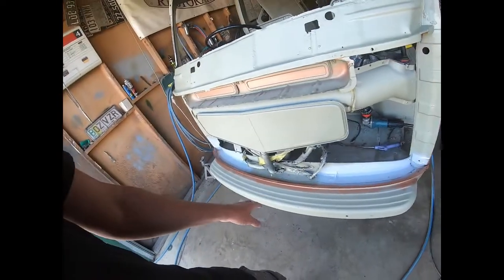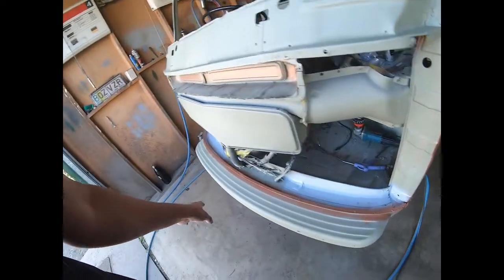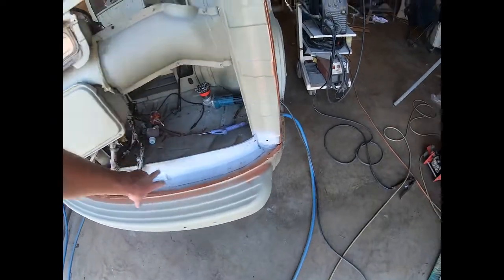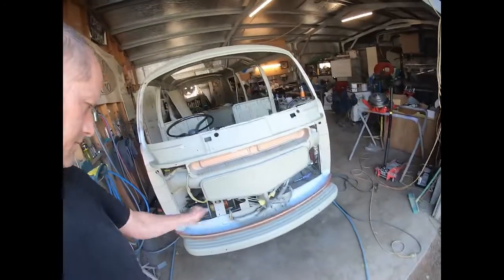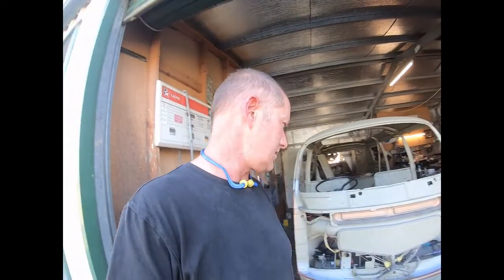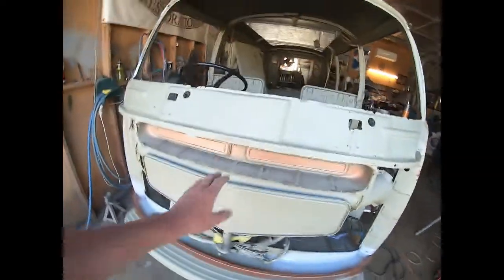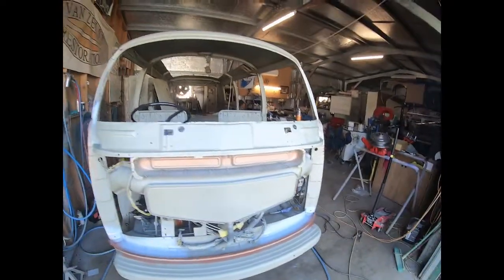When the outer skin's been put on, and all the welding and painting's finished, then all that area all along here, you put the nozzle in and flood it all with rust prevention, and that is all you will ever need. You do not need to do any more than that. All this area in here, you see through the front opening anyway, so obviously that's all going to be painted.